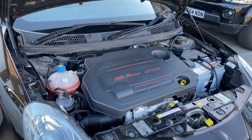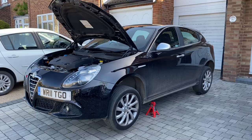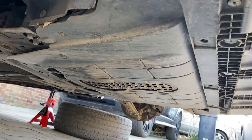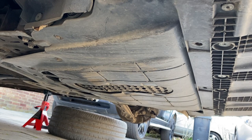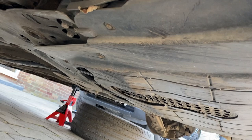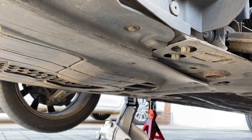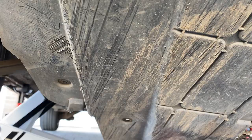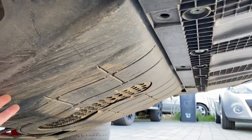It's a great day — hopefully it'll warm up a little bit because it's quite chilly and windy right now. We've got the front of the car up in the air on axle stands, with chocks on the back wheels and a jack underneath for extra support. I've taken just the one wheel off on the passenger side. Next up is to take this plastic protector off — I think it's a number 10 — so I'll go around and remove all these bolts to expose the sump.